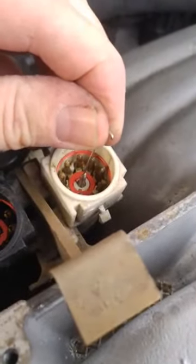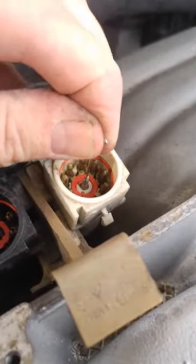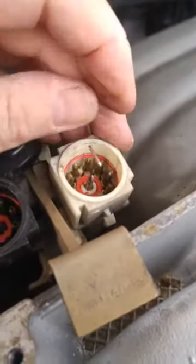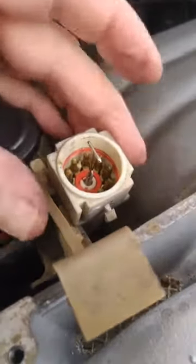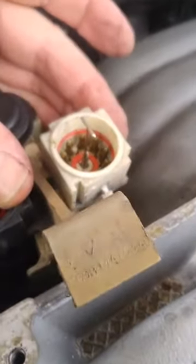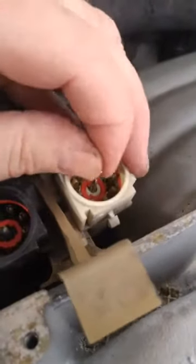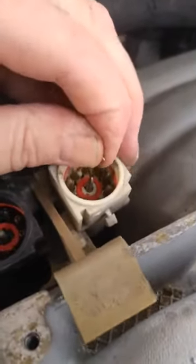This little T-pin is going to go down into the middle of the connector. You'll feel it when you get it right - it'll kind of stick. Push straight down until the T-pin is inserted all the way down into the middle of the connector. Then give it a little bit of a wiggle around to spread the pins a little.